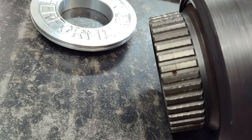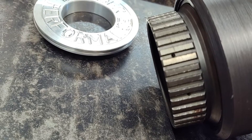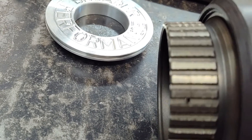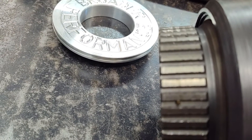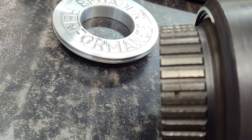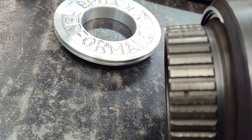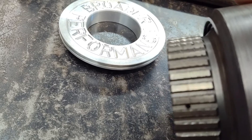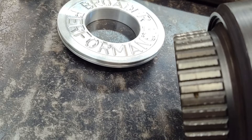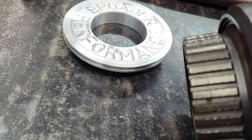If you would put in the comments if you think I should make new pressure plates for these — I don't know how many are still floating around. I still build them but I don't build a ton of them. Everybody's kind of going overdrive, and oddly enough everybody wants a C6 — they're building big giant motors, so the C6 is a good option and relatively inexpensive. So if you want to put that sixth friction in there, you got to do thin steels, thin friction, drop the bottom pressure plate. Bear in mind where you're positioning on the splines — I'm not gonna give you all the exact dimensions and make it too easy for you. I want you to struggle a little bit. You'll figure it out.